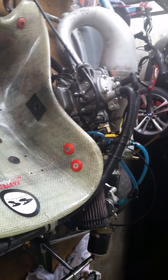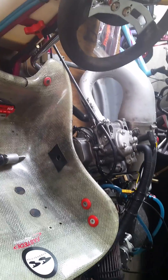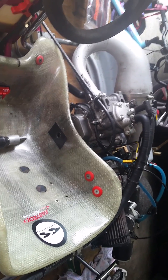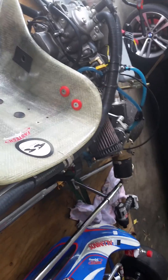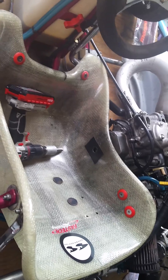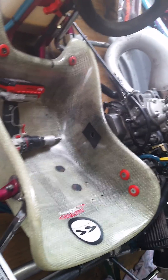It works fantastic. When I started to make this video, this engine had flooded in transport coming back from the last race so badly that as I tried to spin it with the drill, it was hydro-locking slightly and spitting fuel out between the exhaust manifold and the pipe — just squirting out raw fuel. The nice thing is I just put it on the drill, held the throttle wide open, and cranked it until it started. Even though it was flooded and I blew fuel out of the tailpipe, I was still able to start it in under 30 seconds, which I never would have been able to do by hand. It's cheap, works extremely well, and saves us a lot of time at the track. If you have any questions about how it was made, feel free to shoot me a line.